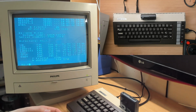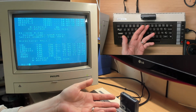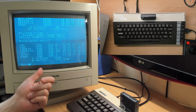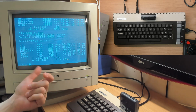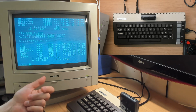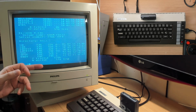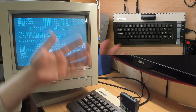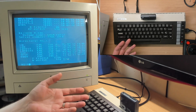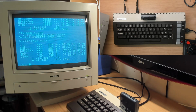So initially, when you first power up and interrogate that FAT16 volume, the DOS has got no idea how much free space is on the disk, so it has to establish it by reading the FAT from one end to another. Now fortunately the hardware is so fast here that, even with the biggest possible FAT16 partition, it can go from end to end and count the free clusters in no more than about 4 seconds. So the pause that you'll get at the end of the first dir command is relatively short, and thereafter, having established the amount of free space on the disk, it never has to do that again until the next time you cold boot into that partition, if you like.